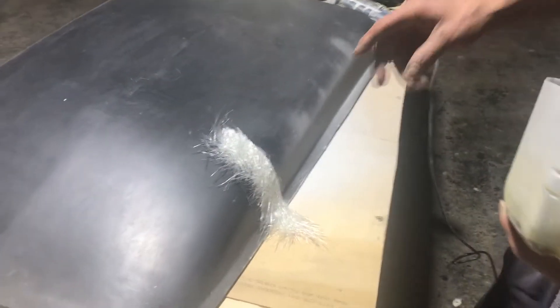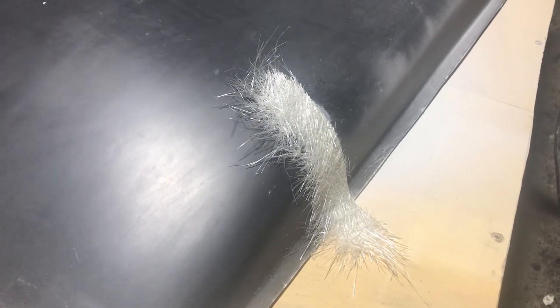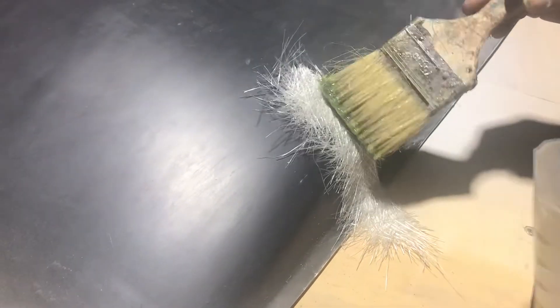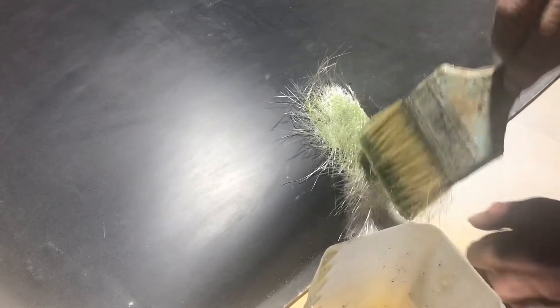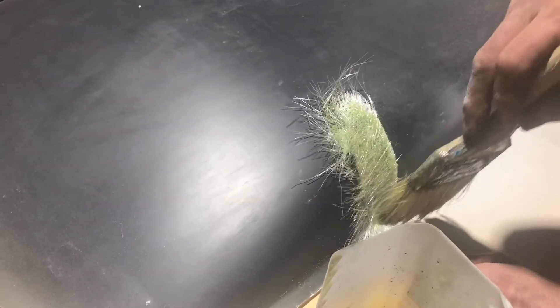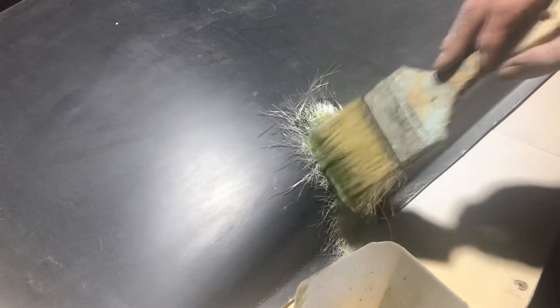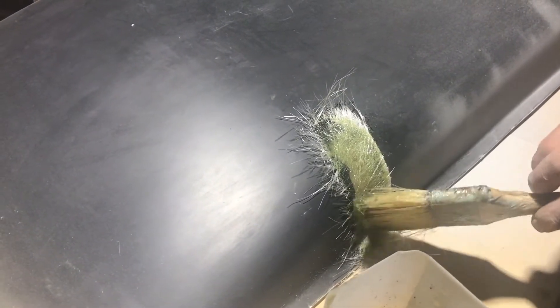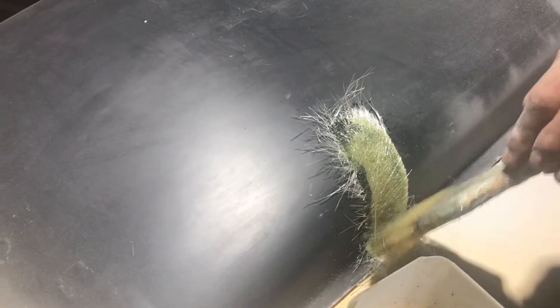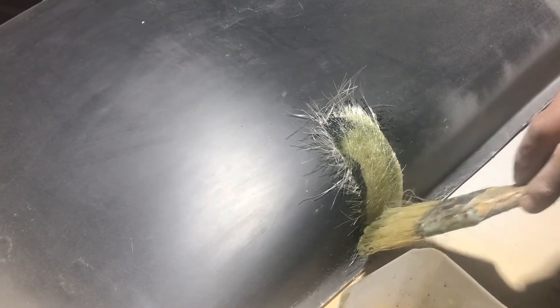Alright folks, this is a little bit of 450 mat — I used a bit of 450 mat on the other side as well, a bit of chop strand. I've just mixed up a bit more resin and we're going to get this happening. After this it's just purely bodywork that you normally do to finish it off. Could have cut the glass a little bit smaller but it'll just come off anyway — once we run the grinder over it we can touch it up.